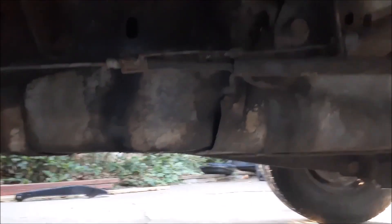For the tank, I added a Walbro 255 that I ended up getting. I had to modify the pickup a little bit because the strainer was mounted to the side, not the middle. I ended up having to do a little bit of work to that, but it runs and drives pretty good.